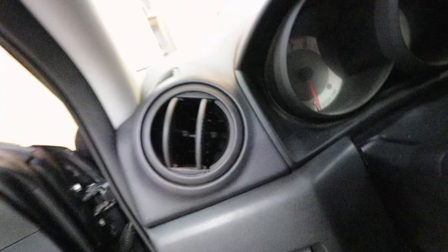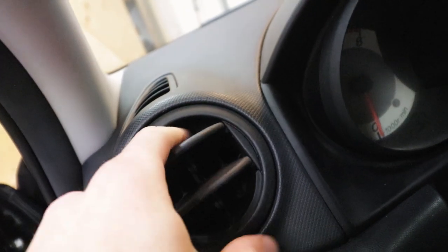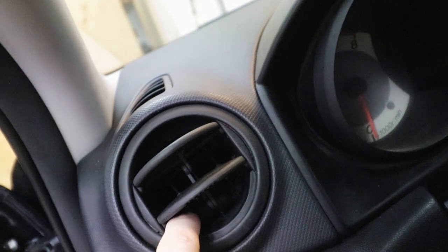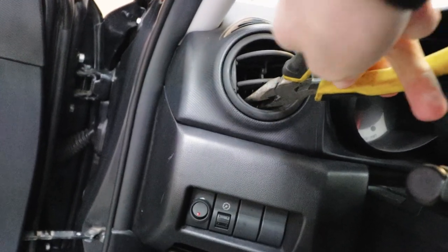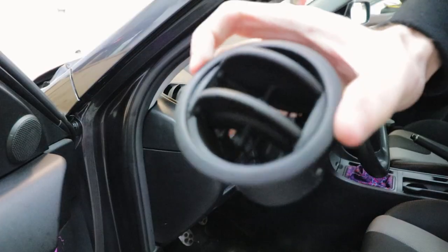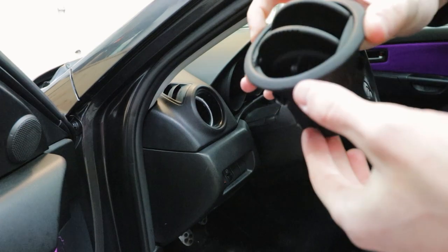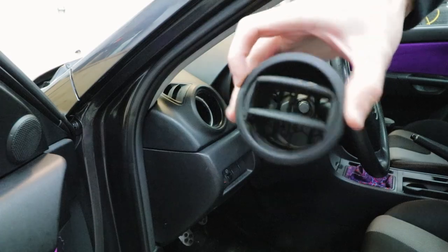Pretty straightforward. You guys look in here - you need to locate the bottom. There are some hexagon shapes at the top, so you just look at the way this is. Flip it up - boom, this is your bottom. There are three little tabs. Don't pull the middle one. Take your needle nose, grab one of the side ones - that's the side one, not the middle. None of them broke. I've seen people grab the middle one and I've seen that one snap because it's so skinny. The ones on the sides are a bit thicker than the one in the middle.